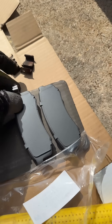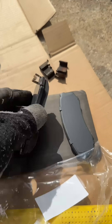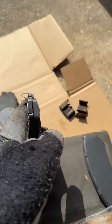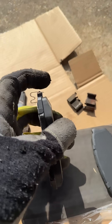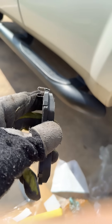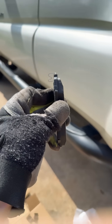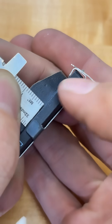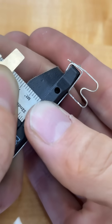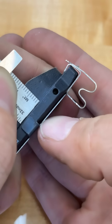Back to what I was going to say before — there's usually a thin steel tab on one or both of these brake pads that reaches out. That extremity right there will scratch against the steel disc once this pad has worn down a certain amount, and then it plays the song of its people. So this mechanical thing does the sensing of the depth of the pad, it does computation against the minimum depth allowed, and then it does the singing of the song as a user indicator — all in this.